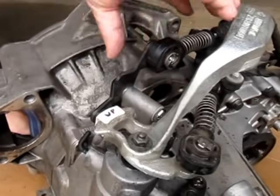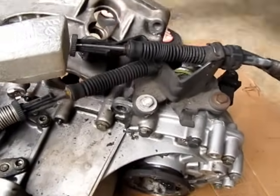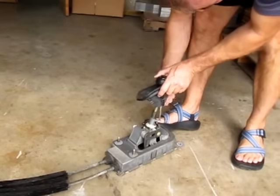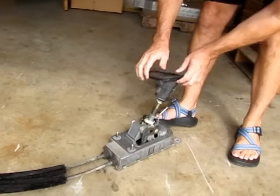The first thing you want to do is open the cable ends, like this, and then go inside the car with your five millimeter pin or five millimeter drill bit. You want a good fitting part — we have a whole video on it. Go ahead and pin the shifter inside the car.